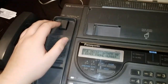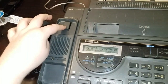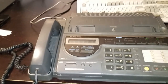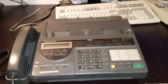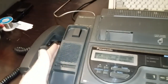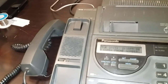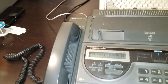The hook switch on the telephone had an issue where, when the handset was on the hook, it still thought the handset was off the hook. I thought this was just a dirty hook switch, and in fact, if you follow me on Twitter, that's what I said it was, but that was just me saving time. What was actually wrong was the hook switch wasn't dirty, but I guess the switch itself has probably bent out of shape over time, and the switch has to be pressed down further than it used to be to close the switch. So how I ended up fixing that was I managed to open this up, and it was convenient that the switch itself was in a flat rectangular shape. I took a piece of Scotch double-sided tape and put it down on that switch, and that raised the switch up enough that now, when the hook switch is pressed down, it closes the switch. So that fixed that issue.